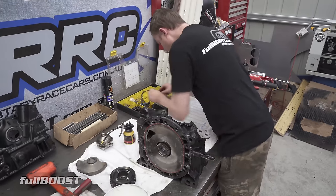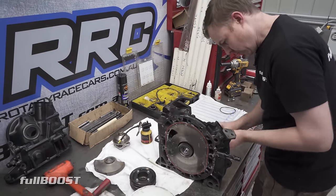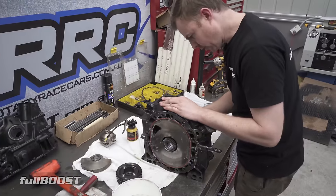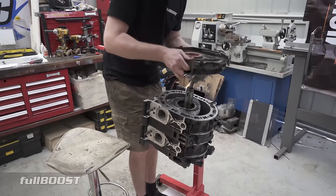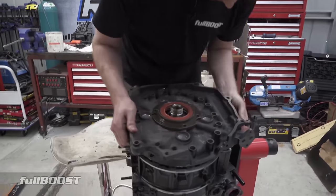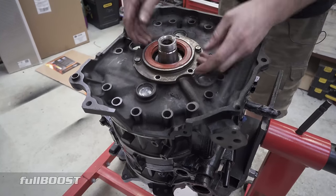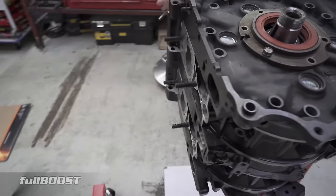I'll just whack a couple of these bolts in now to hold it in place for now — I'll worry about doing these up to torque spec a bit later. I'll set my impact wrench to three Ugga Duggas. There we go. So maybe a tiny little bit of maneuvering to make sure it meshes with the rear stationary gear and the rear rotor. But once that's in, boom, it's in place. What you want to do now is visually inspect everything — the gaps here are all even, you can see RTV poking through in the surfaces, so that's great.